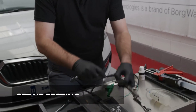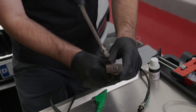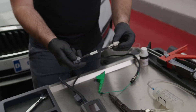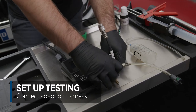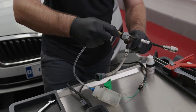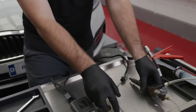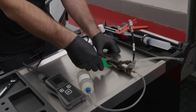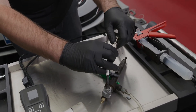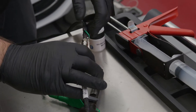Firstly I'm going to attach the high pressure fuel line adapter. I'm just going to nip this and then following this I'll insert the back leak connector. Each injector has a different harness so we'll add this on now. We'll fit the container which will catch all of the excess fluid. So that's us now ready to attach the YDT720 tool. We'll start first by attaching the earth cable, followed by the harness.